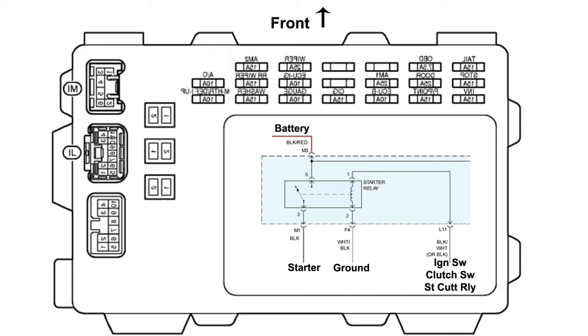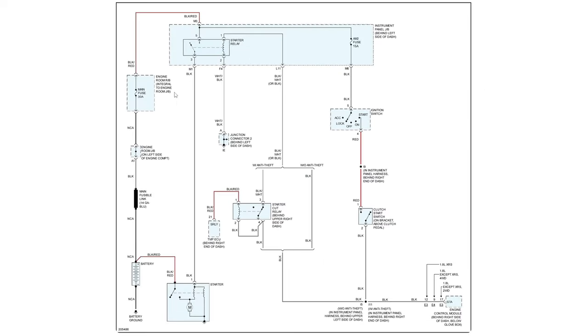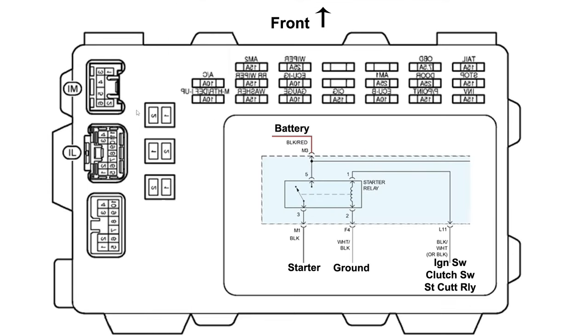And then connector 1 is going to the starter. We could manually power that, say, with a power probe. If it cranks, then, you know, all that's good. Or the other thing we could do, too, is we could just jumper the two, right? They're just adjacent to each other. The thing that's nice about that is with one quick little test, by jumpering them, if it cranks, then you know the entire load side is good. You don't need to check any fuses, you don't need to check the starter, you wouldn't need to check anything. You'd know just by jumpering those two wires that everything is good. So don't always ignore the simple solutions of just a simple jumper test.